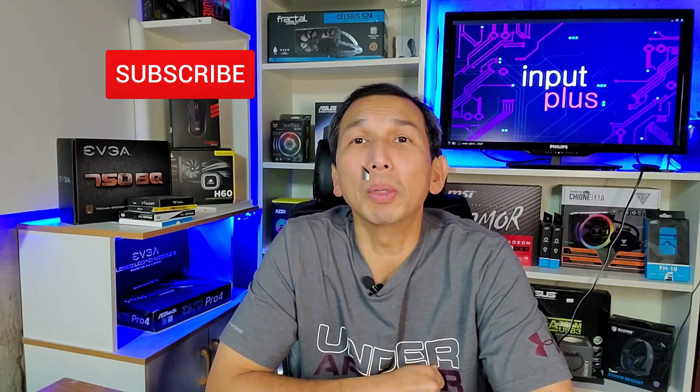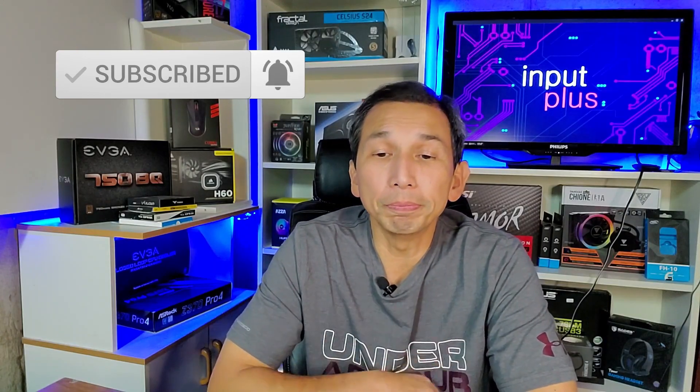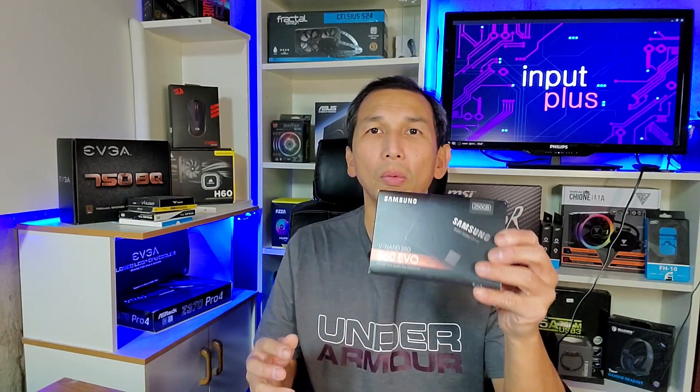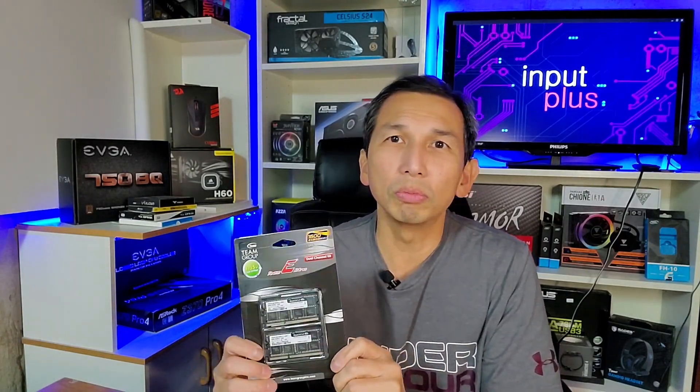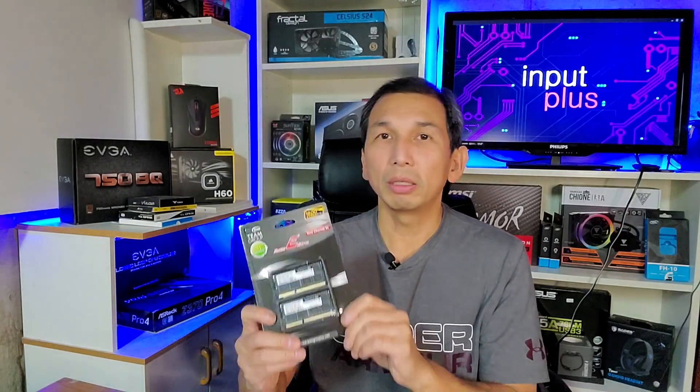But before we do that, please don't forget to subscribe to Input Plus — it'll help us keep motivated to do more videos and you'll be notified when new ones come out. So the upgrades we're doing: we are replacing the two-and-a-half inch hard drive because Windows takes forever to load, and putting in an SSD which will really boost it on load. This unit came with a single 8 gigabyte DDR3 module, but there's an open slot. I grabbed a 2x8 for a total of 16 gigs DDR3 — really cheap nowadays, about $37 Canadian on Amazon, shipped free next day thanks to Prime.